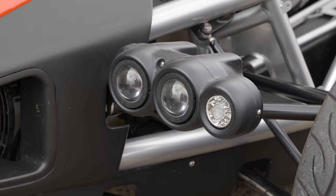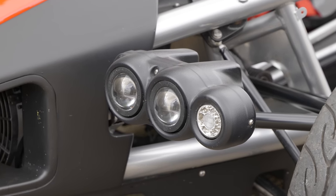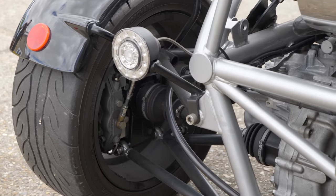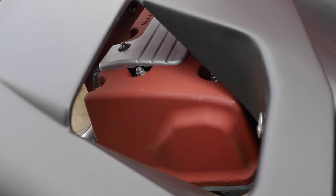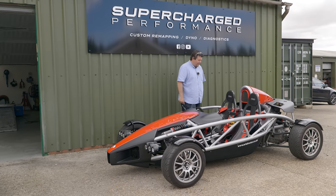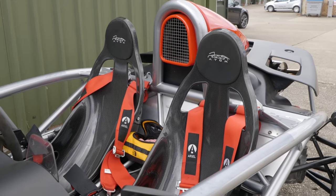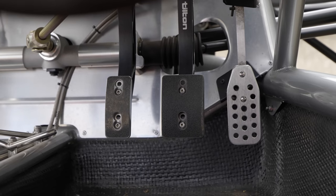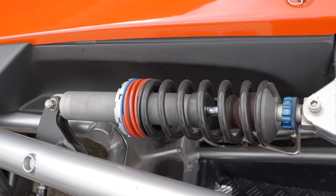You want response, and you simply don't need big torque in a car that only weighs 600 kilos. This, at the back, has a Honda K20 which has been supercharged and now produces 310 horsepower, giving it a very, very healthy power-to-weight ratio. This is what's known as an Atom 3.5, introduced in 2014, and though it looks very similar to all the others, is different to the cars that came before. You have a pair of ultra-lightweight carbon seats, steering wheel, very race-inspired dash, cool-looking gearbox in the middle. The tech heads will be interested in the inboard pushrod dampers and double wishbone suspension front and rear.